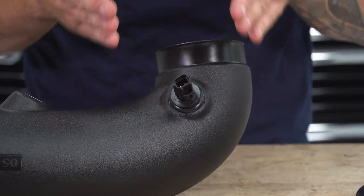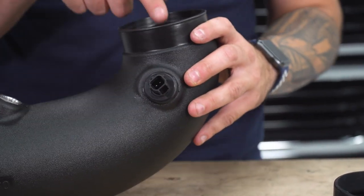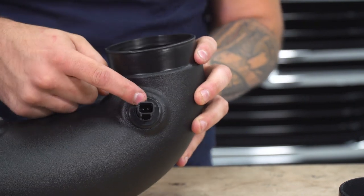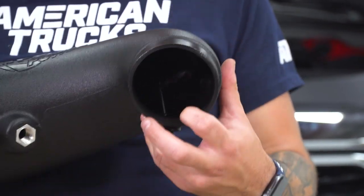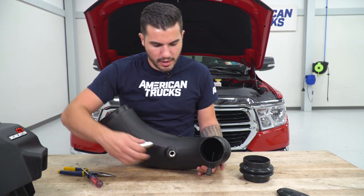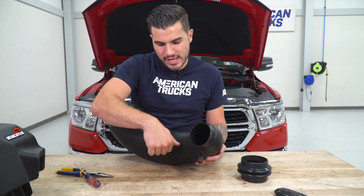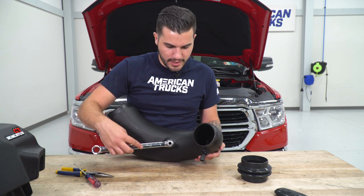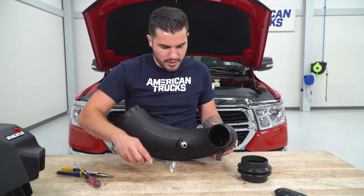Make sure the sensor is oriented the right way — the little tab on top, opposite the connector clip, needs to be facing the throttle body opening. Take the whole unit and twist it so that tab faces the throttle body. You can also look directly inside and see the little blue dot, which is the sensor — that needs to be facing the same direction. Next, take the hose fitting and thread it directly into the threaded hole next to the sensor. Grab a 20-millimeter wrench to tighten it down. Note that it will not sit completely flush — it gets tight before that, so don't over-tighten and strip it out. Just get it nice and snug.